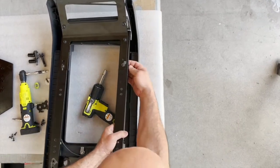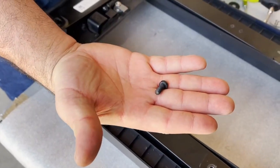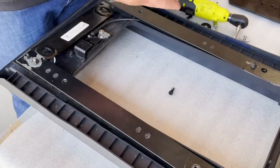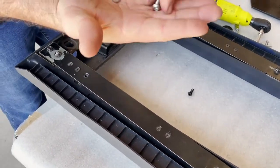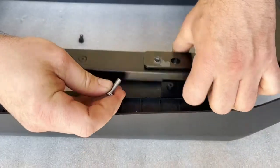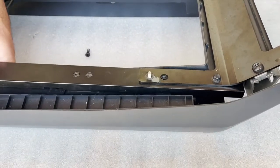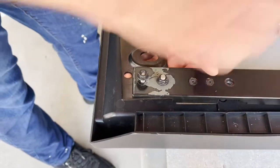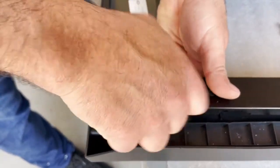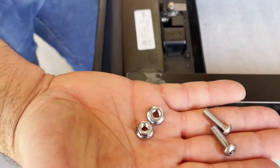We are going to remove and replace the upper bolts. We are replacing the existing bolts with M6 stainless steel — slightly longer and a lot stronger hardware. The two on the top take these spacers, and it's critical that you put the spacer on the bolt and then the bolt through the bracket, essentially making the bolts shorter. On the bottom there will be no spacer; simply replace the existing bolt with the supplied bolt. These are stainless steel with serrated nuts, which don't need any other type of locking fastener.